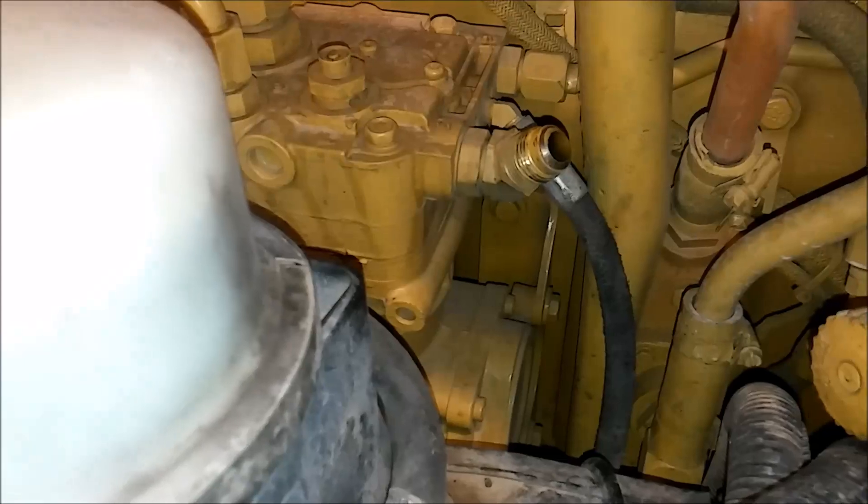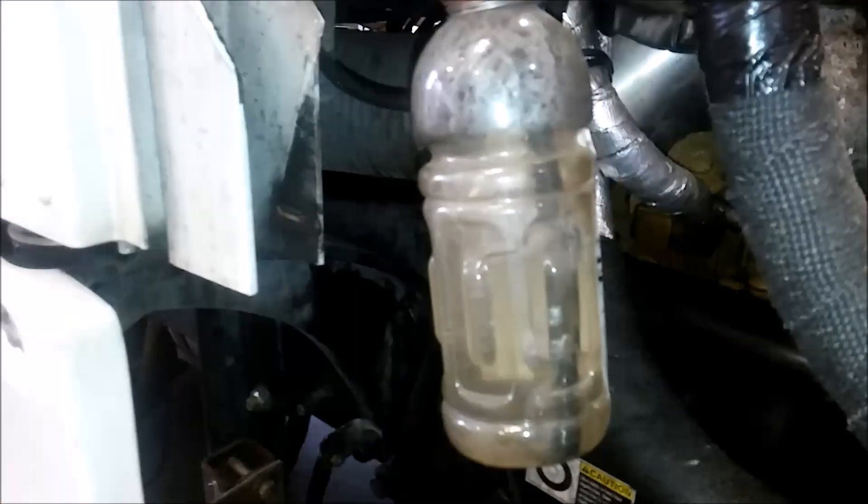Now that is a lot of bubbles — you shouldn't really see any bubbles at all. If you see bubbles, that means pressure or air pressure is getting into your cooling system. To eliminate your air compressor as the cause, remove the hot hose line off of it. If the bubbles really stop when you remove the line, you know the air compressor was the cause. But like I said, it's not usually the air compressor. You can see there were a lot of bubbles getting into that bottle — the cooling system should not get any bubbles in it.